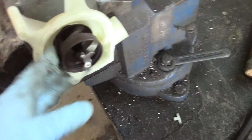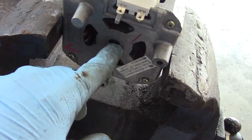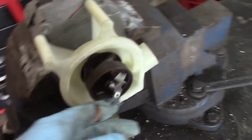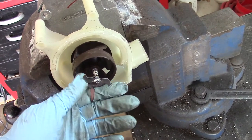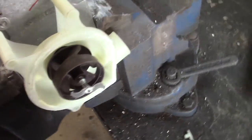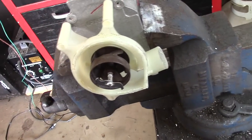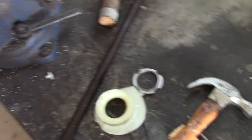So here's what we have with the motor part. Originally when I was working on the dishwasher, I could see the back of the shaft and the motor spinning nice and true. I could reach in through the top of the dishwasher and feel this little blade when the thing was off — wobble it, see if there was any play or blown bearing — and I couldn't feel any wobble. Every once in a while the dishwasher would start making that grinding noise. Right now when I look at this thing there is no play whatsoever and everything looks super smooth. We'll plug this in and see if it runs true, and if it does we'll know the problem dealt with these two pieces.